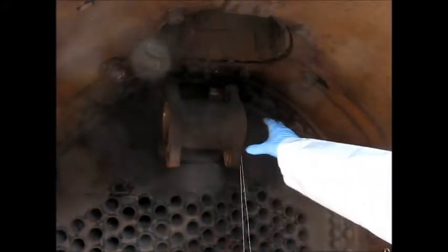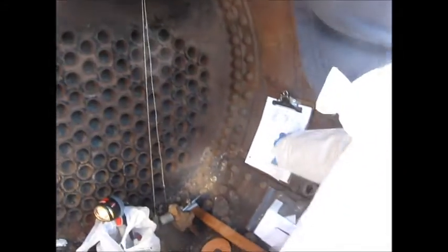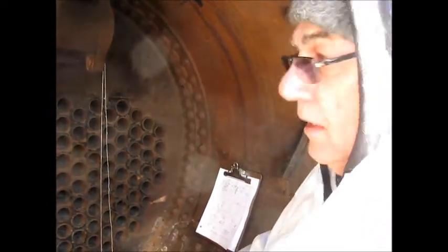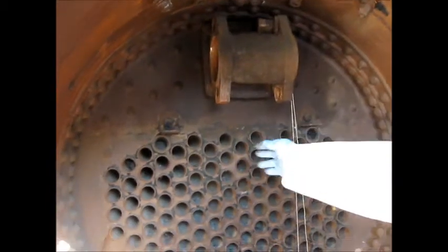What I found out today, Josh, is that you've got water on the other end and it's heated up, and the steam comes down through this header and through these header housings, which I'm making — I think they call them header pipes. Those are the castings. The hot steam comes down through here into the cylinder and then it pushes the rods to make the wheels go. This in here gets to be about 400 degrees. They have a screen here which keeps the soot down when they blow out of these pipes. And this cavitation along this metal here is the result of all the turning of all the hot steam in here.